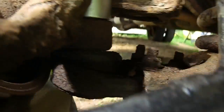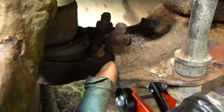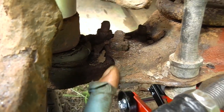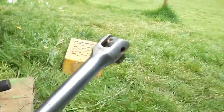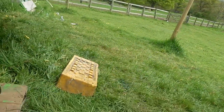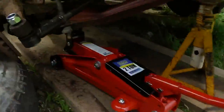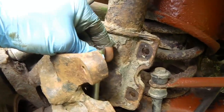Generally to get these ball joints out, they can either go straight forward or be a pain. The trick is to soak them well with some penetrating oil and leave it for a couple of days. Get yourself a decent breaker bar - it does help to have a bit more leverage. Just have to crack them off and away you go. I've got the bar on there now, so let's see how we get on.